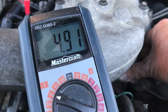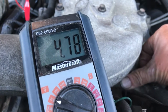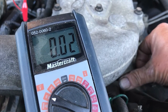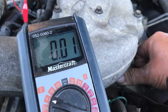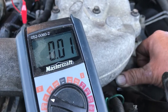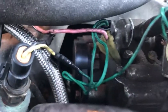...at full application it reads 4.91, and when I come back here just a little ways — halfway right there — in the most traveled portion, I might add, where it's used most of the time. So anyway, there's the problem: it throws it into limp mode, hard shifting, overdrive — and that's your throttle position sensor, which is located, in my truck, at that block device right there.